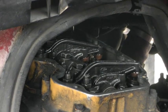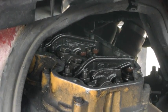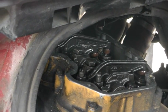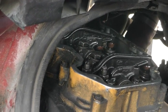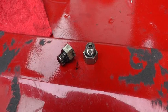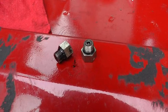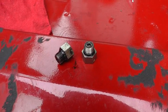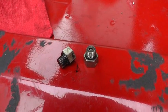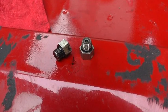This oil drain plug that was on the part of the head underneath the lip of the firewall was much more difficult because I couldn't directly see it. But I just took my time, put rags all around in the oil galley so I wouldn't drop anything in there, loosened up the bolt, and drew it out with a magnet. It's important to get these out so the oil can drain before you remove the injectors — otherwise oil drains down into the cylinder and when you crank it over you can have a hydro lock and bend rods. So you have to pull these out and let the oil drain.